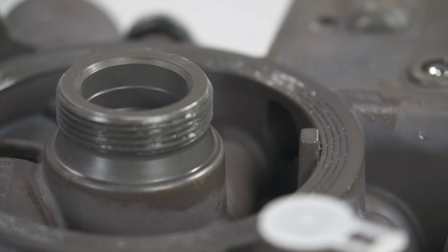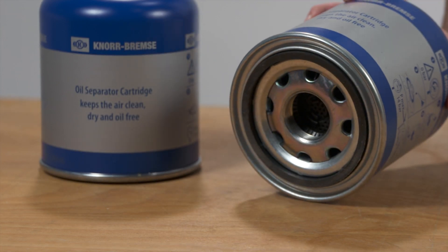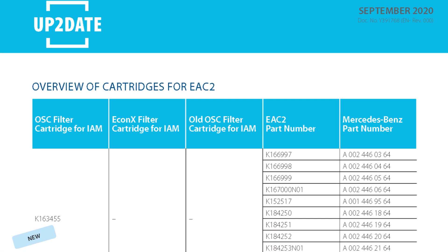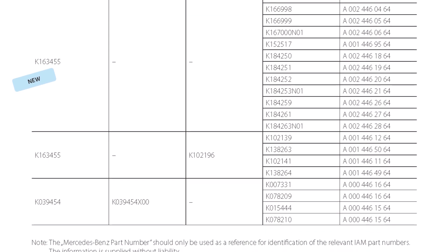The EAPU-EPB has a pin on the sealing surface, so only the new unique air dryer cartridges suited for this purpose can be used for replacement. The inner cover sheet next to the sealing ring on the cartridges is step-shaped, which allows the air dryer cartridge to be completely screwed onto the surface. Information on Knorr Bremse air dryer cartridges can be found in the product information.